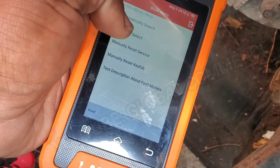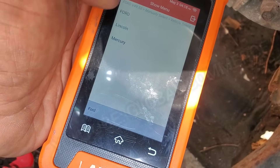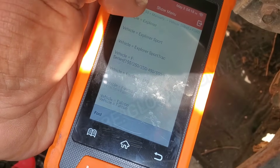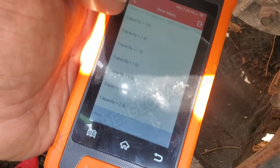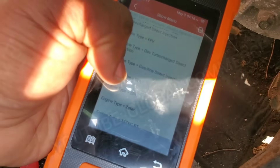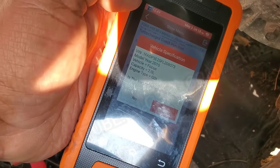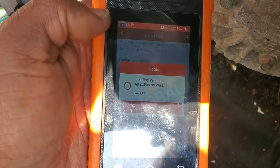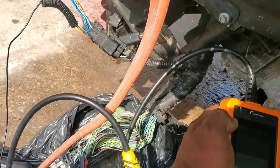I'm going to do a manual select — select vehicle, Ford — and I'm going to find Focus. Focus 2.0, and this is a GDI I believe. And there it is — it detected. Yes, that's correct. So we're actually talking on the CAN communication lines right now, right here from under the vehicle. You do not have to be at the OBD port or anything.